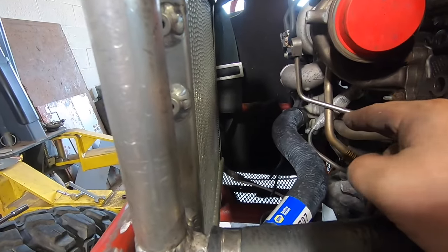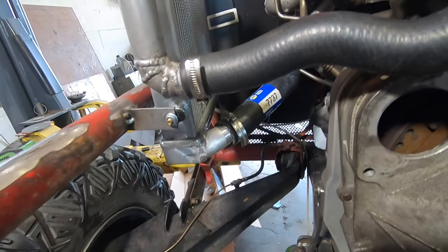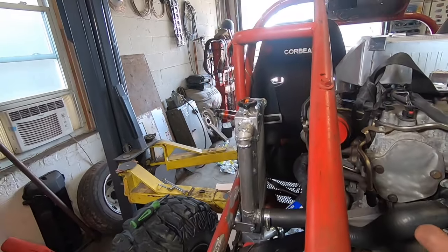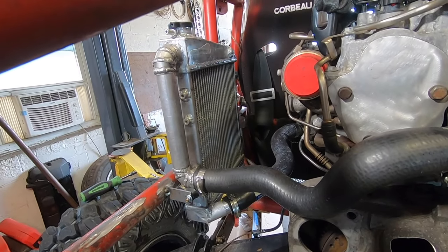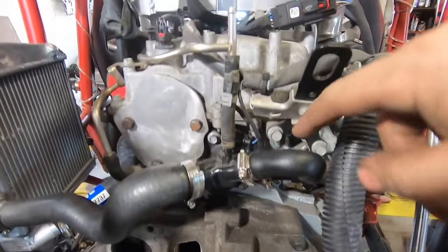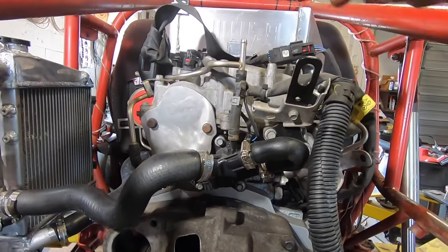Front hose fits nice. I ended up flipping that thermostat housing. As you saw, that was kind of a job. Custom port down here. Patched up the top port on the rad. So the rad really is, there's nothing left to it really. I ended up remaking the whole thing. It's probably better rads out there I could have bought. Anyway, onto here, basically just looped the heater core lines with one of these LS motor heater core loops.